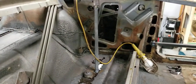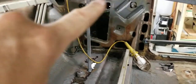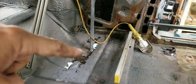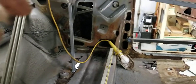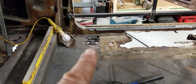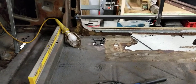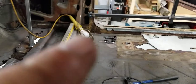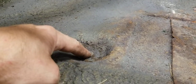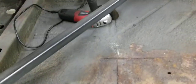Trying to get the body all squared up. You can see we've got a brace right here going from the top of the quarter right down to the frame through the floor. That was to hold that quarter there — we jacked that quarter up a little bit because it was sagging due to that body mount right there being blown out. That was about a quarter of an inch too low. We got that set to approximately three quarters of an inch now, which is the same depth as this passenger side one here — about three quarters of an inch deep from the top of the surface down to the bolt.